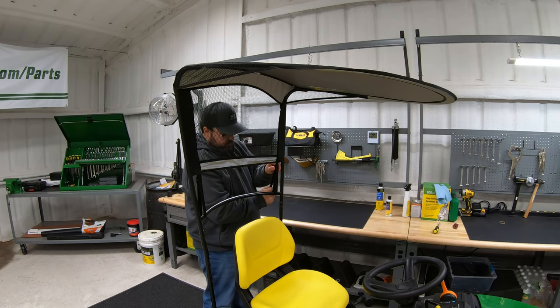Now let's talk about the mower deck — this is the hot topic on any mower because we want to know what we have underneath the machine cutting that grass. What we have here is going to be the 48 inch Edge system from John Deere, a single piece of forged 12 gauge steel that makes up this 48 inch deck. With the 48 inch deck you are going to have three blades, and along with those three blades you're going to have three spindles on top that we need to be greasing and taking care of. You are also going to have bolt-on spindle covers on the left and right hand sides that not only serve as spindle covers but also act as belt guides, so make sure those are put back on correctly after cleaning.